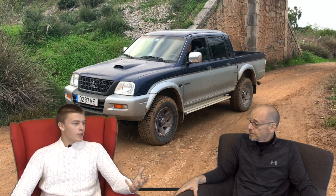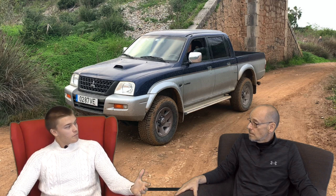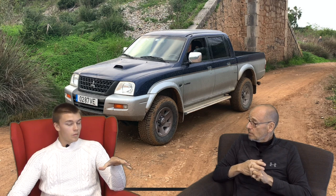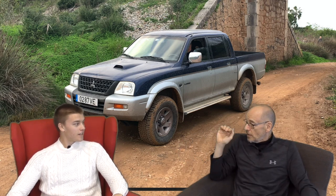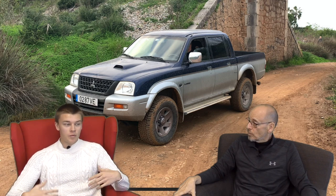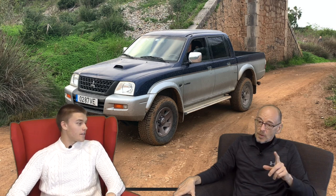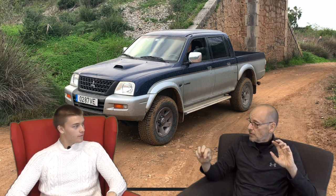Since doing the build - the last video was the rebuild video which only went up a couple of days ago - the suspension off road doesn't seem as massively different. It was quite firm and very well adjusted to cornering before, which it shouldn't have been really, but it was because the dampers were knackered. So we were sort of expecting it to be worse around corners. The only thing noticeably different is over speed humps at speed - the fronts you don't feel it now but then you get jolted at the back because of the leaf springs. It actually absorbs the bumps at the front now, which it didn't before. We filmed before we did anything - we put GoPros underneath and filmed ourselves up in the mountains.